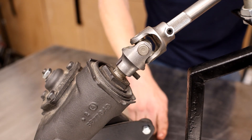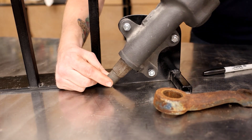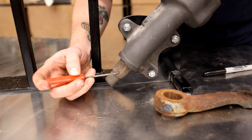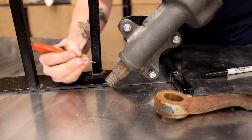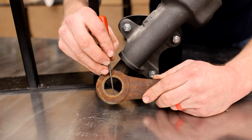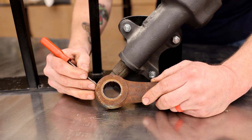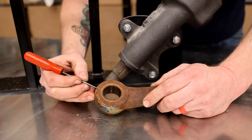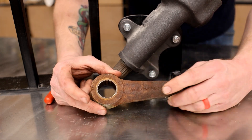The reason for that is down here at the Pitman arm shaft. The reason you don't have to have your gearbox centered to the final degree is because of these segments right here. You'll notice that there is a spline missing in four different positions — here, here, on the backside, and directly underneath. That corresponds with the Pitman arm, which has a wide block and is only going to sit in one of four positions. When all of this is in the vehicle, it actually will only fit in one position. So as long as you are really close on the centering, you should be in good shape.